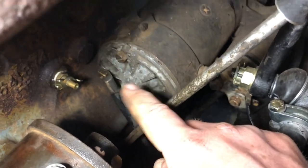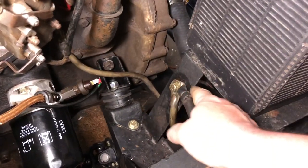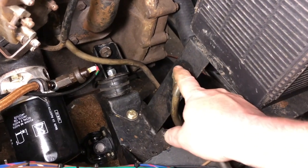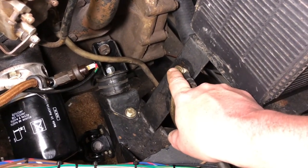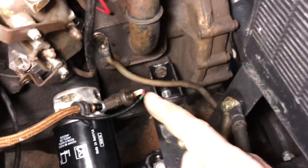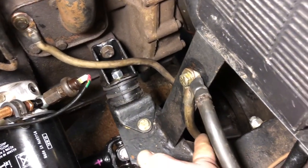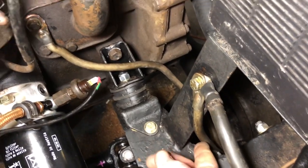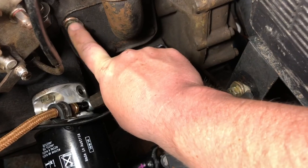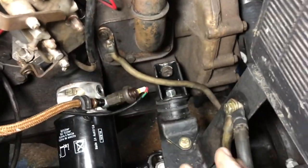This is still the original cable and I have it cleaned up and attached going over to the frame. I have this as a ground and I also added an extra ground to the other side. Here we are on the other side — this is how I have my negative coming down, bolted into right here, which is not the original place. I drilled a hole and I have the negative going to here for the chassis — it's welded to the frame, it's all connected. I didn't trust that other old ground wire, so I added an extra one. I cleaned up the bolt, put a new washer there and polished it all up, so I have that bolted here going over to the ground. The engine's getting a good ground all around, to the battery directly with the cable.